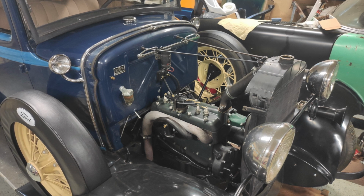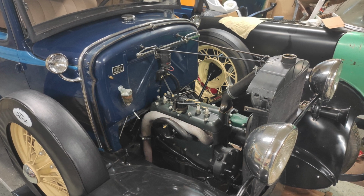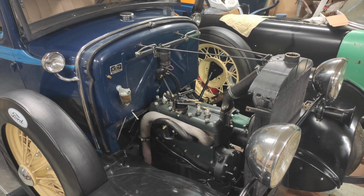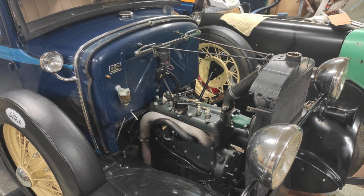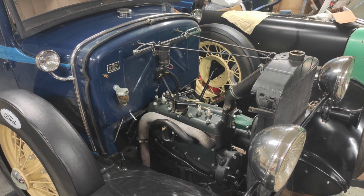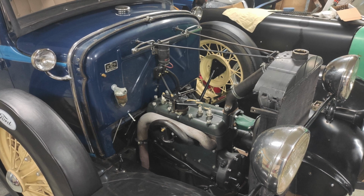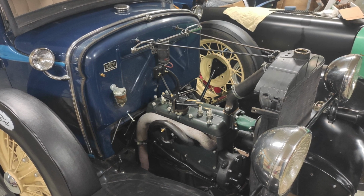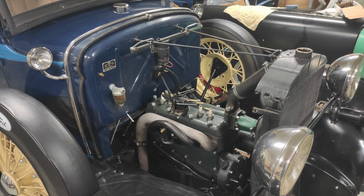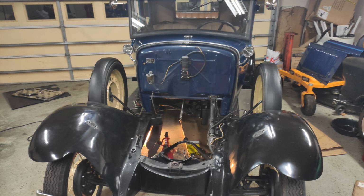I did the old engine block, which you can see here, in the exact same color, but as we get near towards the end of the build, I've now had the opportunity to build 3 of these, and the one thing that stood out across all the builds has been the consistency. Everything has gone together the exact same. All of my clearances so far have been pretty much the exact same. The only differences I've run into with the blocks have been the thrust washers and just having the clearance of those, which has been something I have expected during the build.